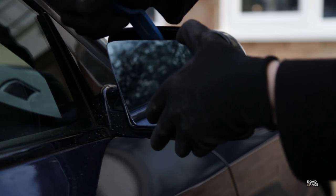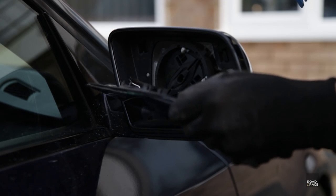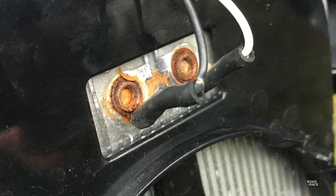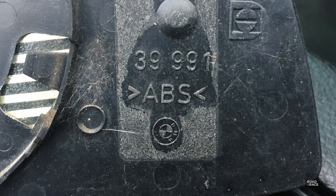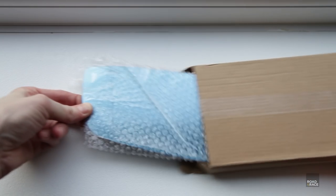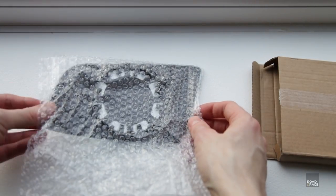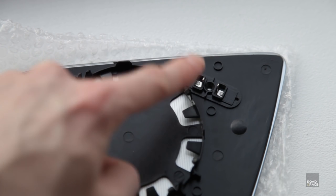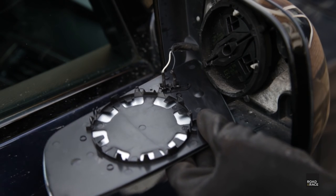You may remember from a previous video that my driver's side wing mirror wasn't heating like it should. My first step in troubleshooting it was to take the glass out — it's actually quite a simple process, you just need to get a plastic tool behind it and it pops straight off. As you can see, it's not a genuine BMW part and the terminals have rusted. If you compare it to the working mirror, which is a BMW part, the design is much better and the terminals are much better protected. An official BMW part is a whopping £126, but I found an aftermarket one online with the same connector design as BMW's for just £10. Here it is fitted, and it now heats correctly.